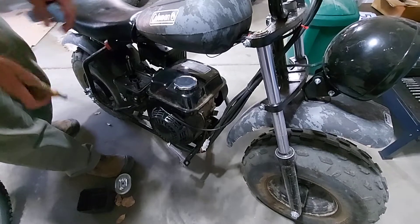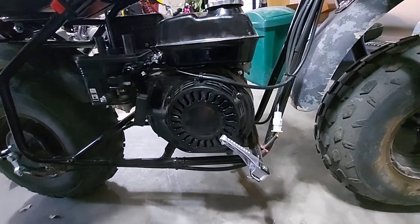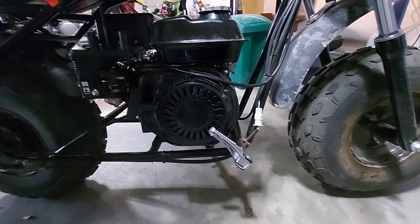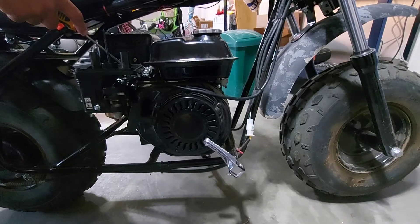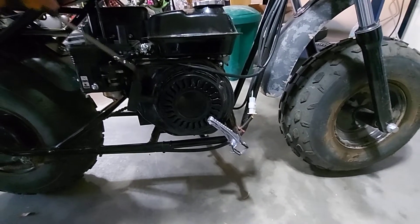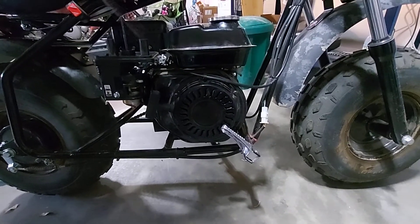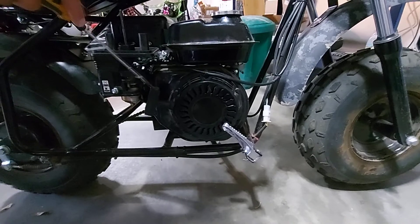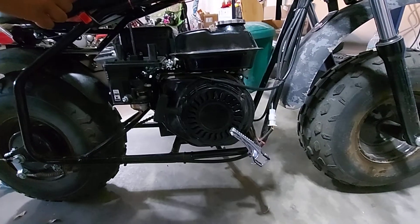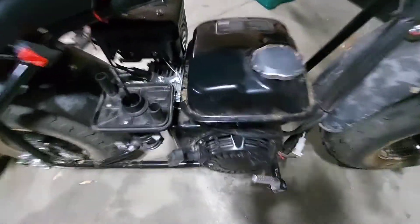Once everything's back together, turn your bike on and pull the ripcord. What's going to happen is for about 10 or 15 minutes you're going to cloud up your entire neighborhood with some smoke, because no matter how much oil you get out, it's going to burn some off. Now if you do this whole exercise and your rope is still locked up, it means you didn't get enough out. So go back to square one — take the wire out, take the spark plug out. You won't get any resistance on your rope anymore. Get the oil out of here, give it a lot of hard tugs, oil is going to keep squirting out and you're going to want to remove it.